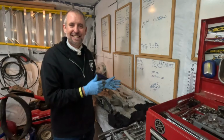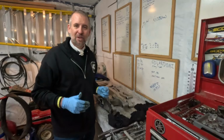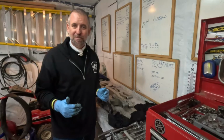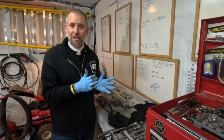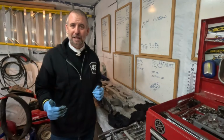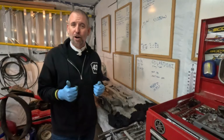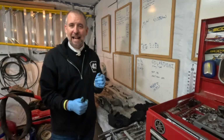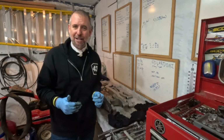So we're going to call that time lapse, the greasing of the resting of them, then the assembly. When we get to the assembly, it's extremely important to use a torque wrench. These are suspension parts, they're moving parts. Too much torque, you're binding your suspension, the bike won't work properly. Not enough, it may fall apart. It's especially important for me to use a torque wrench since my arms are weak. I'm not sure if it's tight enough or not, so the torque wrench will let me know, hey, I'm actually good.